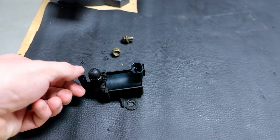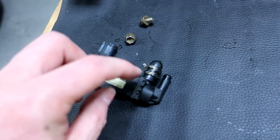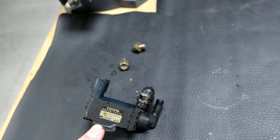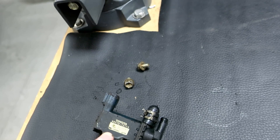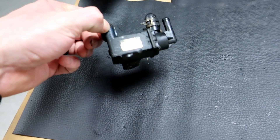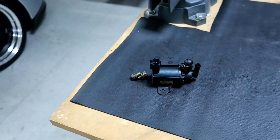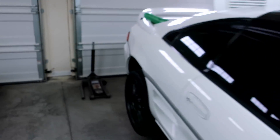Here's the sensor I removed — this is your TVSV. It's pretty much like a Mac valve in the sense that it uses a vacuum reference to send reference to the actual wastegate, and it limits the turbo until it warms up. Until you reach a certain temp, the wastegate spring in them is about eight PSI. When cold the TVSV is off; once the car warms up, it turns on, holds the wastegate shut a little bit longer and lets you reach about 12 PSI. When you do a manual boost controller, guys run 15, 16, 17 PSI max, but you need to get rid of this or cap off the piece. I decided to remove the entire piece before it gets damaged anymore. Someone might actually want it — if you're looking for it, let me know, you pay shipping and it's yours. If you truly need it to help your car, I want to try to help someone out in the community.